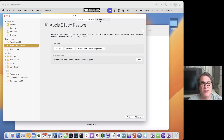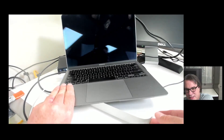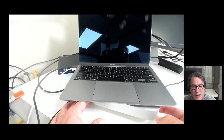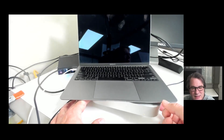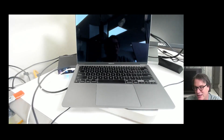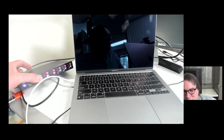That's for doing it one-to-one — one Mac restoring to another. But we want to be able to restore at a larger scale. If you have a lot of machines to wipe and reinstall in parallel, what I have here is a Mac Mini underneath this MacBook Air — an M1 Mac Mini, actually in DFU mode with an amber light. Instead of plugging directly from one machine to another, I'll plug them both into this Acroname Hub.